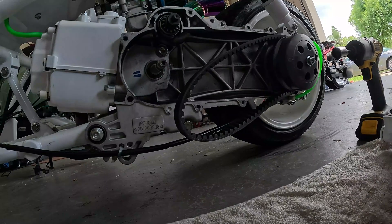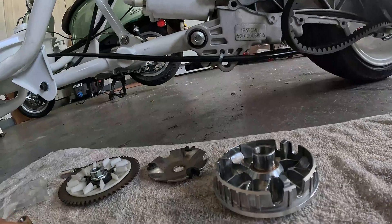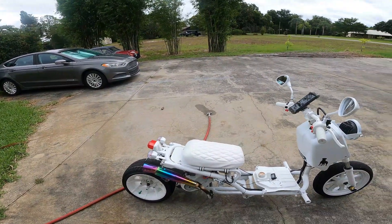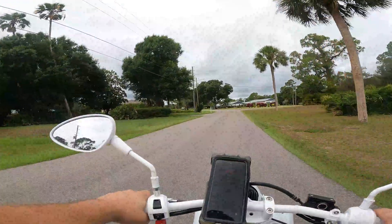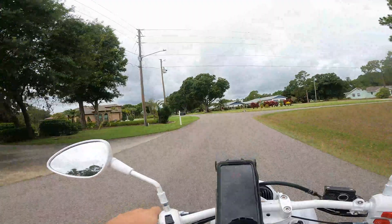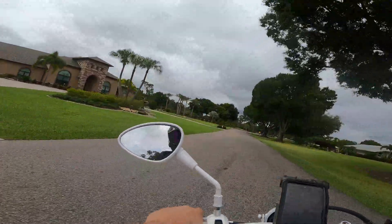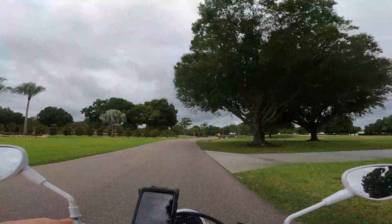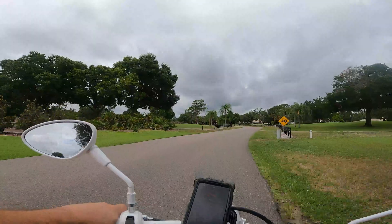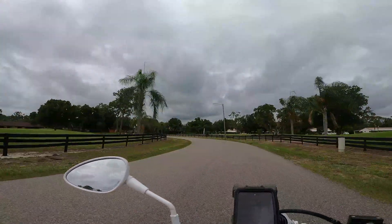It's really a gear-up mod, so we're not really running heavy rollers on these MedDogs like they are on regular scooters. I think these four-gram might even be too heavy for it. It idles nice and low — sounds good. The four-gram rollers already feel better. It doesn't go crazy on the RPMs now. There's 8,000 — it's about 1,000 RPM lower. Hopefully I'll still be able to make RPM up top, but this is a lot nicer for just cruising around.